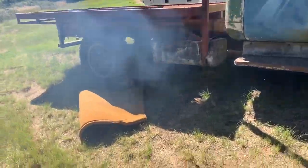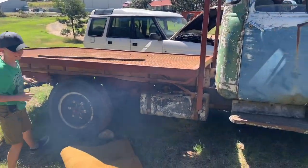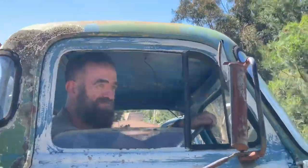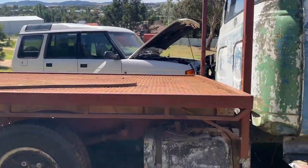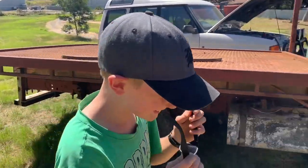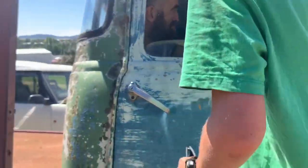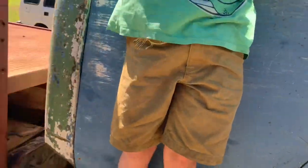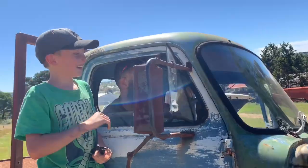Wow — yeah! Let's make the exhaust like this — sounds good, eh? Are we smoking? Oh yeah, well, given we had almost no compression to start with, then we got oil through it, the rings started to bed in, built up some compression and then it goes. There's a whole heap of oil that we squirted in there now burning off — that's the blue stuff. And there'll be a fair amount of oil going into it by the normal procedure as well.